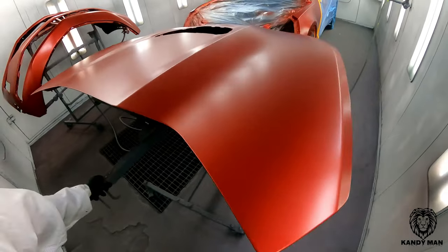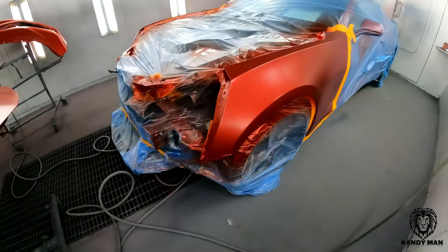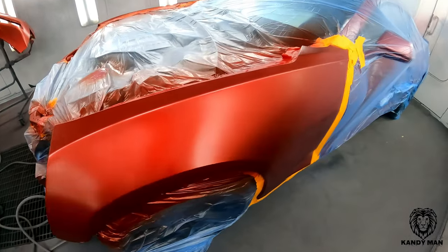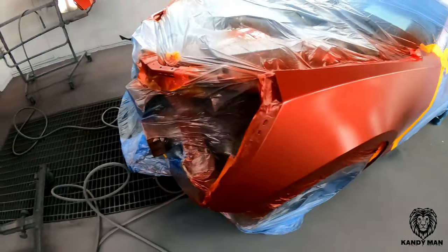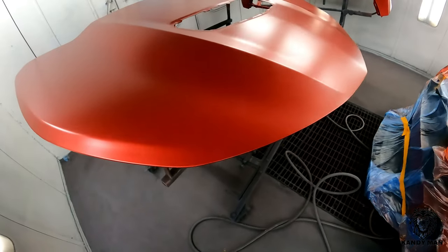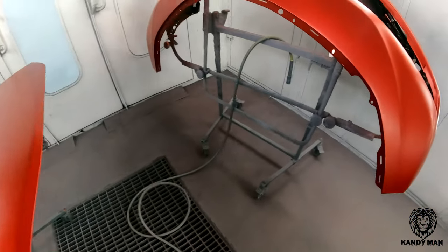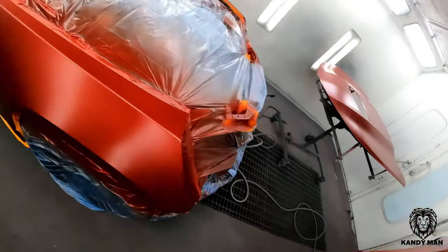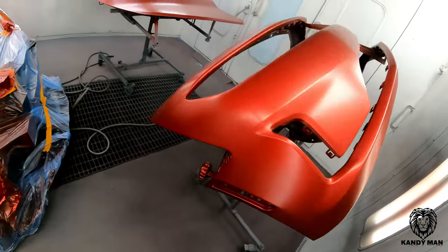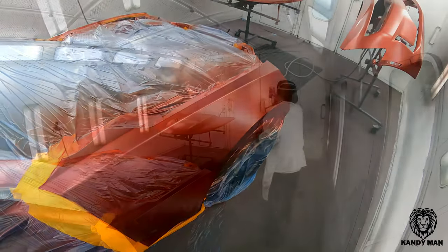And that's in the water base we're shooting here, if you guys are new to this channel. So we shoot the Sherwin-Williams Ultra 9K. And this one here is ready for the candy coat. We're gonna put two coats on. That's what the spray out card I have is called for, that I checked, and it matches the car. So let's go ahead and put our two color coats of the candy on, and then we'll get right into that LPH and lay this thing down real nice and wet.